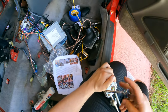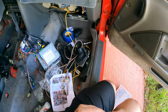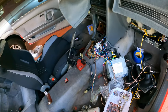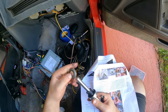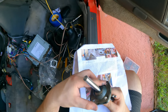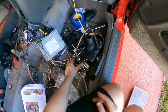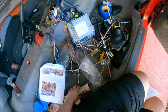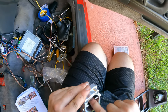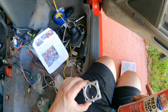These pieces are so small, you've got to be really careful. I do not recommend doing it the way I'm doing it with so many things going on at the same time, but this car's had pretty much an interior revamp going on. Spring pivot washer - plate, will it fit? Seems to be fine. The grease wasn't actually for the bottom bushing, although it is on there - we need a light coat for this green bushing inside the shifter seat. We also need to add the grease to the pins of that shifter seat.